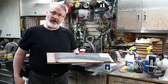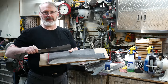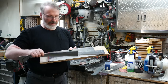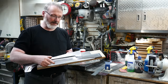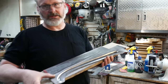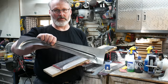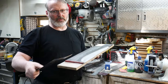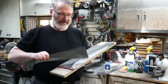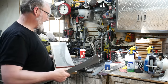If you joined us for part one of making stainless steel trim, you'll know we made the metal die, mounted it onto some wood, used a little bit of long strand kitty hair bondo, set in our stainless steel blank, and used our air riveter with homemade tooling to get it formed. Then a bunch of stuff broke — it turned out the setup was just a little bit soft to stretch the stainless steel enough.